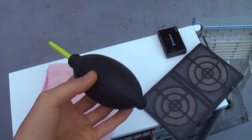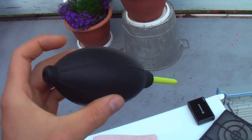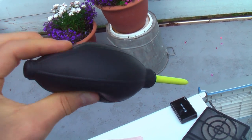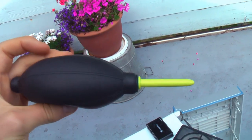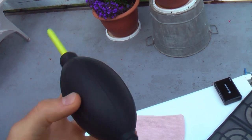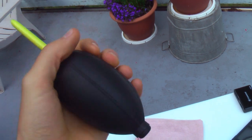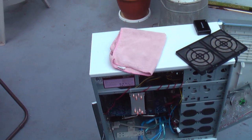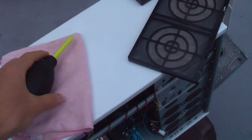The tools we'll be using here are pretty simple. Here's one of these air blowers. Please don't use a vacuum cleaner or an air compressor because those will leave liquid or build up extreme amounts of static charge. I've actually fried a motherboard vacuuming out a computer a while ago. You can also buy cans of compressed air, but this has always worked well enough for me and once you buy it you don't have to spend any more money on replacement compressed air. We'll be using that and just a dry microfiber cloth — don't wet it down, it shouldn't be necessary.